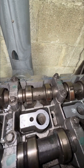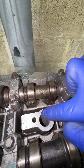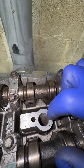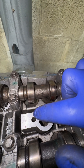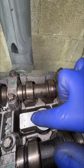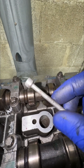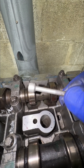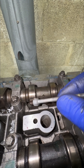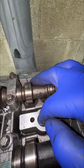So you've got a couple of options to repair the broken bolt hole. Number one is use an extractor, try to take the bolt out, and then either put the original bolt back or you can drill this hole to M7 1.0 size. Mercedes actually sold a bolt just like this one, same design, but in M7 1.0 size, and that's a much better upgrade. But in my case, the bolt couldn't come out.